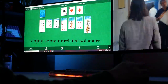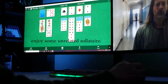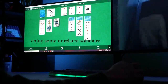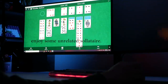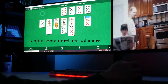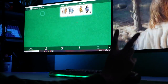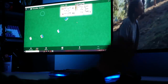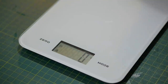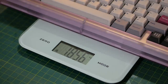We have lubed T1s in here. These are a medium weight tactile keyswitch with the bump right at the top, which is strong and pronounced — wonderful keyswitches to use and some of the best tactiles you can easily acquire. While the bump is strong, it's nicely rounded and smooth. The combination of the brass plate top mount design and the polycarbonate case provided a kind of bassy experience. It wasn't as tight or as dense feeling as other high-end aluminium boards. There is that slight feel of relief, and the bottom out is slightly softer, which I guess makes sense. It's not a bad thing, just different, and I do love typing on this.